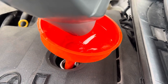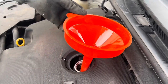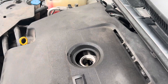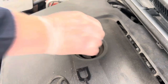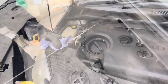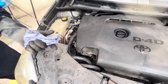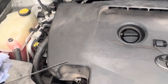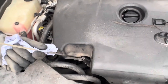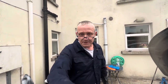That's the last bit in. Lovely job. The thing about filling the filter housing — that wouldn't have filled it completely, because there's still a lot more to fill in there. So I'm going to put the cap back on, fire off the engine, and see exactly where it is on the dipstick. I'm going to dip it now — look at that, it's absolutely perfect, right there at the top. 6.7 litres is what you want from empty to drain. That's exactly how it's done. Subscribe, thumbs up, hit the notification bell, and thanks for watching. Take care.